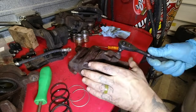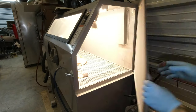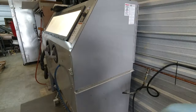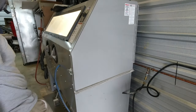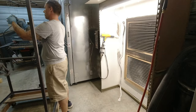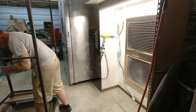Finally, remove the brake bleeder screw, and these are ready for sandblasting. Throw them in the sandblaster for just a second. Clean. I'm giving these a wipe with a microfiber towel and some acetone, just to remove any remaining sandblasting media or grease.